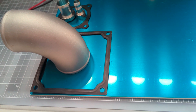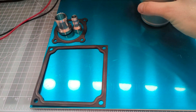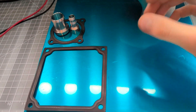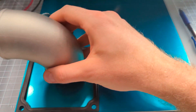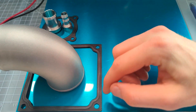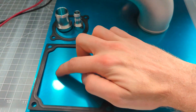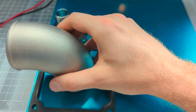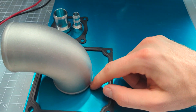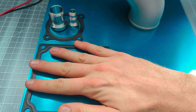On to the next step, which is designing the flanges that will seal against the M65 supercharger's openings. Seen here are two of the gaskets intended for the supercharger. The larger one is for the output of the unit. My plan is to cut this into a square — this is eighth-inch aluminum — use a hole saw to drill a two and a half inch opening, then position the elbow on that opening and use a brazing rod to join these two together. At that point, I'll have something ready for the outlet of the supercharger.